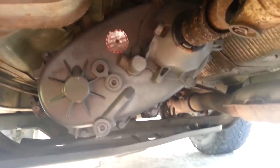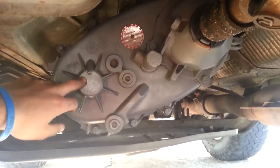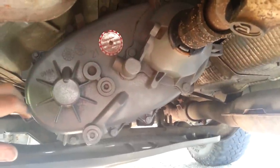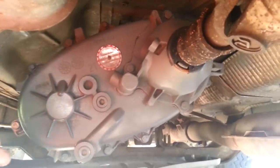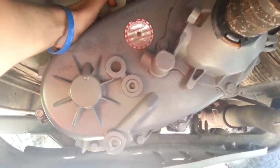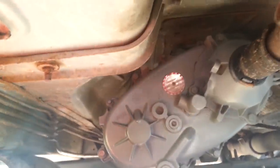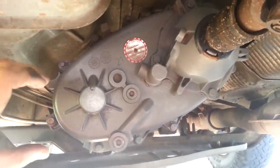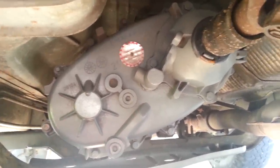The 242 takes automatic transmission fluid. There's also a wiring harness connector on the top — it's not required, you don't need it. But there is a connector on the passenger side of the drop. There's already a wiring harness connector up in that area on your Jeep. All you have to do is remove the male or female end and connect right into it. What that does is on your dash light, it'll indicate when you're in four wheel drive part time. Kind of cool, but not required.